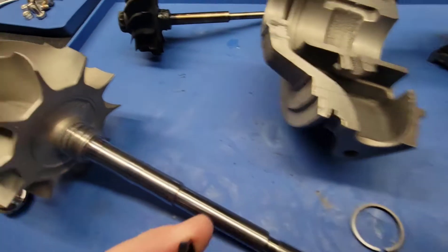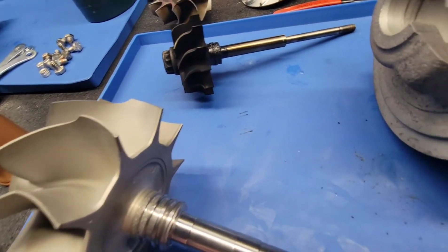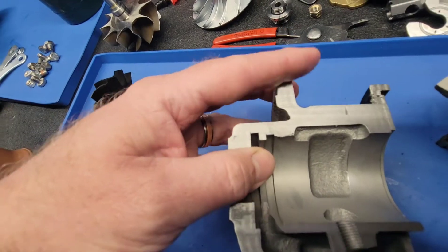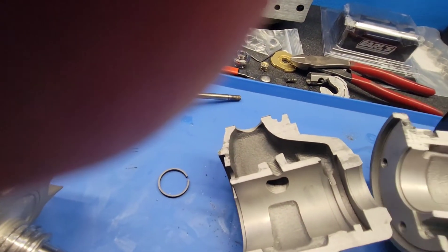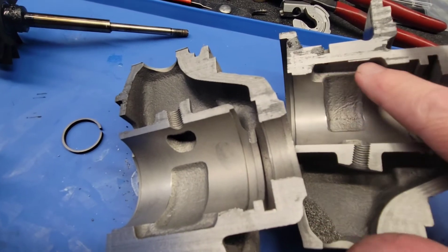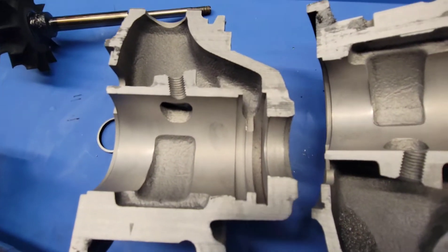Piston rings. Turbine shaft. These piston rings fit into those two grooves on the turbine shaft. They then snap into the bearing housing, into the exhaust seal bore — this area here that I cut right through. This is your oil inlet. That's your oil feed hole right there. It goes in to this passage here and then oils both bearings. As it travels through the bearing pack, hopefully this will make sense to you guys.